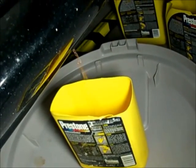Okay, this is the front of the Durango. If you have a 2002 or 2003, this is a 2003, you have a small opening in the actual bumper itself, and you can actually put your hand in there and get to that valve, and that's the valve right there. If you don't have that, you can reach it from underneath. Now, as you can see, the system's flushing a lot faster now that I opened up the main radiator cap, which is mounted on that top radiator hose.